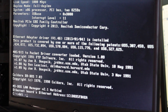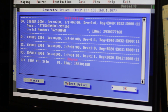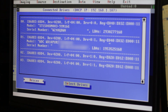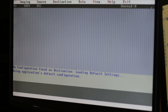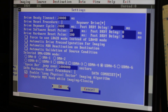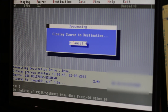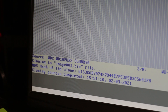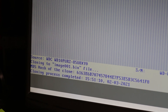So DDI space dash L saves the log. We don't see the source drive yet — we're going to hit F11 and the drive will spin up. Here's the destination and here's the source drive. The next step is to enable MD5 hashing. We're going to format the target drive — this writes a file system and it's going to let us save a bin file onto the drive. We're going to clone to an image file; you can see in the corner it says image.bin. It's saving right now, and we're done. A few hours later we got the hash values — those are very important.